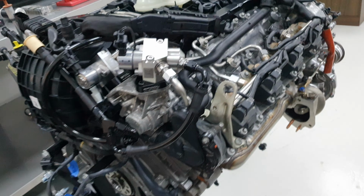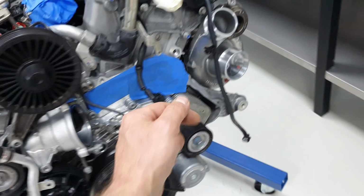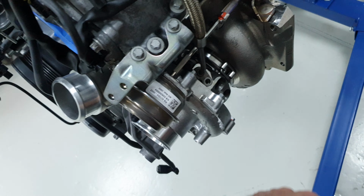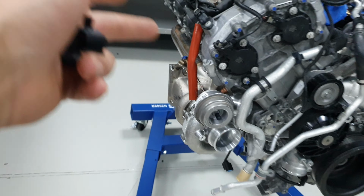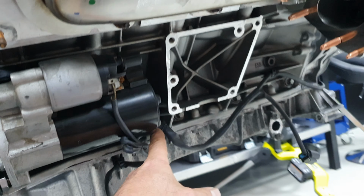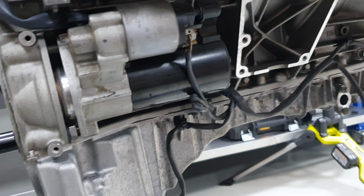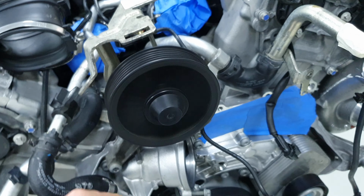All right, it is what it is, right? Turbos, like I said, in place. I haven't put this bolt because I don't have it. And I want to put also one string of oil inside on the feet of the turbo here. Obviously, alternator, AC compressor, and the rest, engine mount brackets, the collector, the starter, I already put them on. I haven't tightened the M6 10mm nut here, or the positive. And I need also another clip for down here, because it doesn't have one like that. So that's the status, small update. This pulley, I need to change it. This is the old one that makes sound.